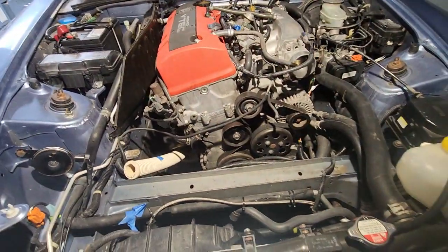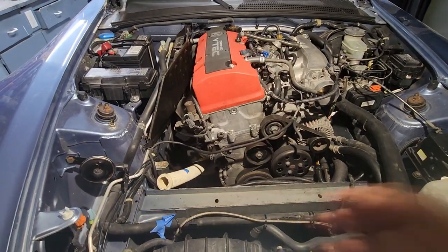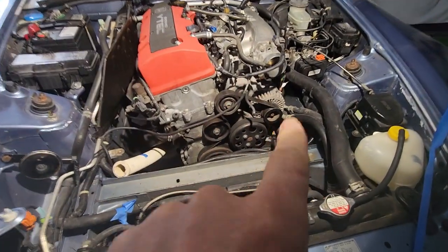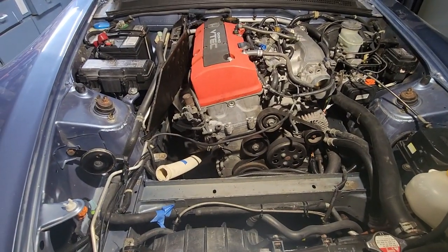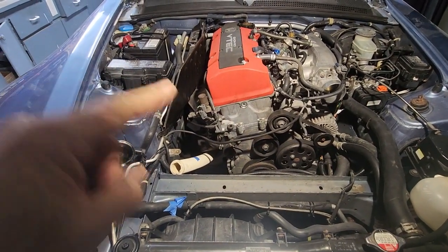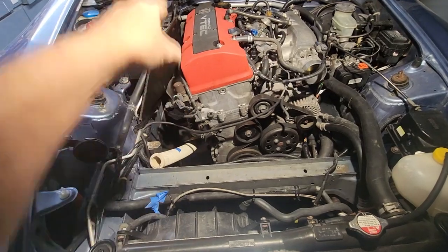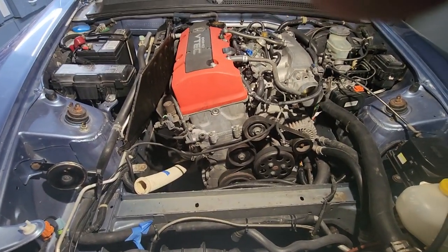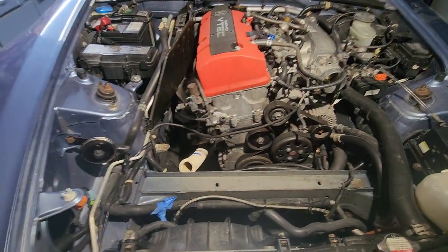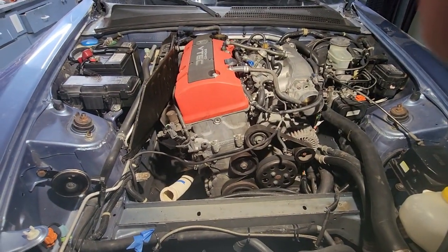I'll use it for my first try. Any pressure drop in the charge piping and intercooler reduces system performance — if you want 6 psi at the throttle body and you have a 1 psi drop in the piping, you've got to generate 7 psi at the supercharger, and that takes more power from the electric motor — about 6 more horsepower. The more pressure drop, the harder the electric motor works, which is one of the main things we're trying to minimize. I'm hoping to keep total pressure drop to less than 1 psi. We'll see how well that works.